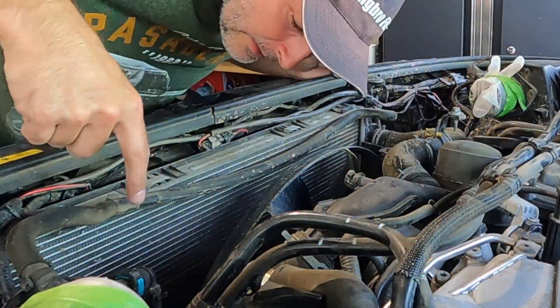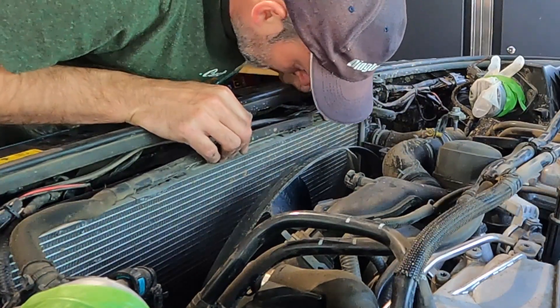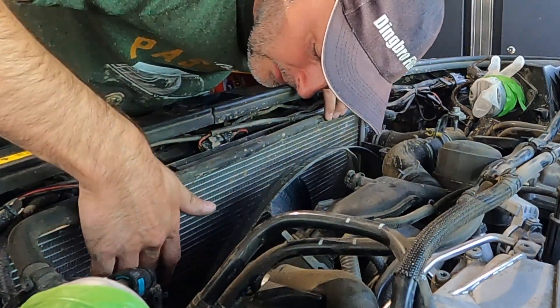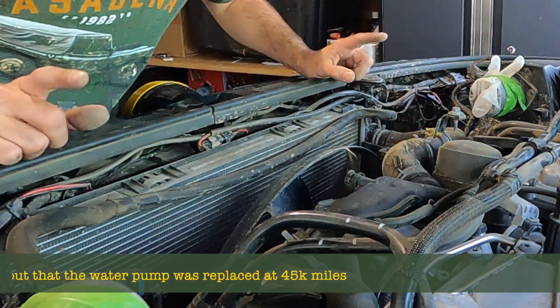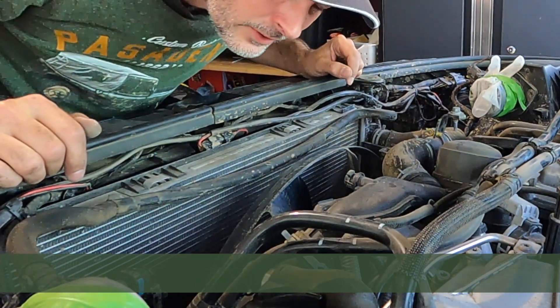While you're here, just check on the inside of your radiator — any debris, any dirt, and any damage. Now I can see on this side here there's a tiny little bit where somebody squished the fins. So at some point that shroud's been off to do some other work. What other work that would be? I have no idea.